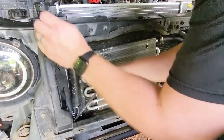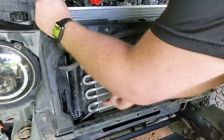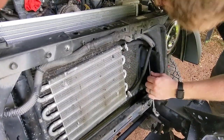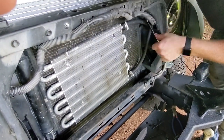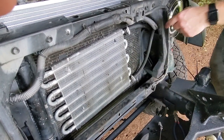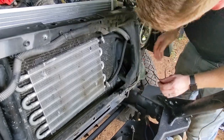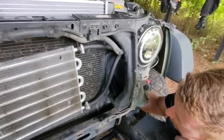Assume tightening these bolts down would help make sure things align, but one of the issues remaining is that this shield does move independently because it's not a hard metal shield. So the bracket itself with the condenser has to line up to that shield, that hole, and then go into the threaded portion of the radiator itself. That's the issue we're running into a little bit right now.